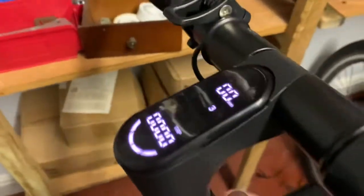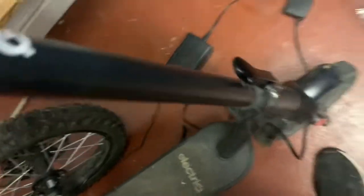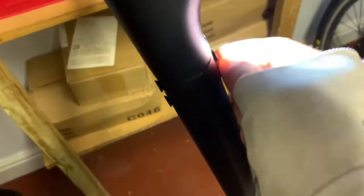Light's still good. Obviously this folding mechanism — there's a bit of play on that, but that's happened a couple of times. You've got to tighten up an allen key bolt in there; it's not too difficult tightening up the handlebar. You've got to keep checking them.